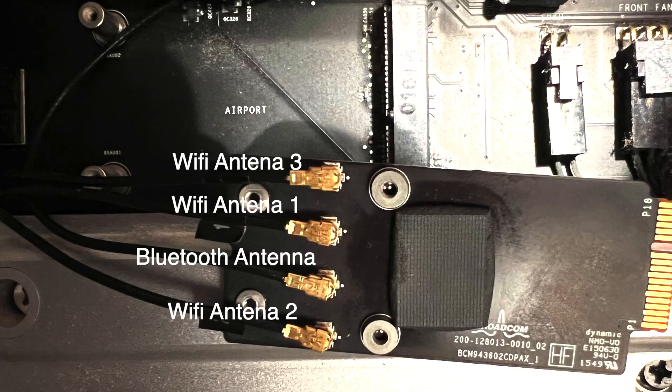I was able to place the Wi-Fi card on the ridge of the Mac Pro and get each antenna right above where it needs to be, then push down and pop it in. That's the easiest way — instead of fumbling around holding the card yourself, have the card laying flat on the ridge and hold it down so it's not moving. You can move it forward or back to get it right under the antenna. Twist the cable so it's pointing down naturally, position the card right under the cable, push down, and it clips in. Just be patient — do not force it or you'll bend a pin.